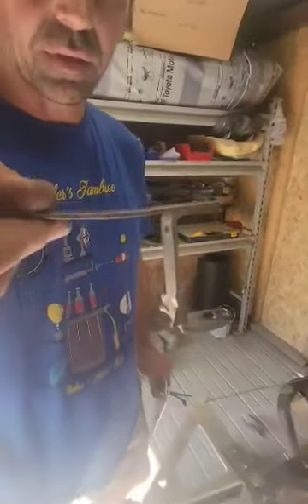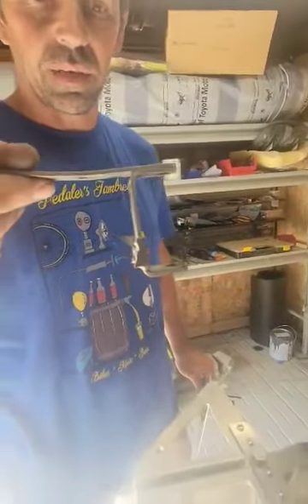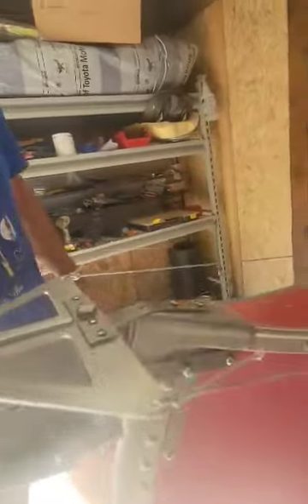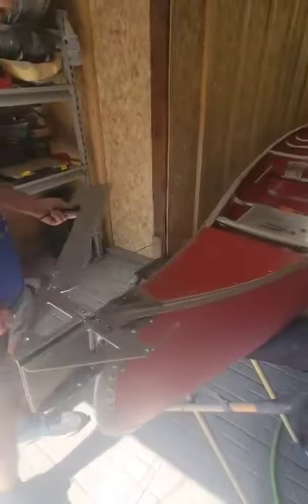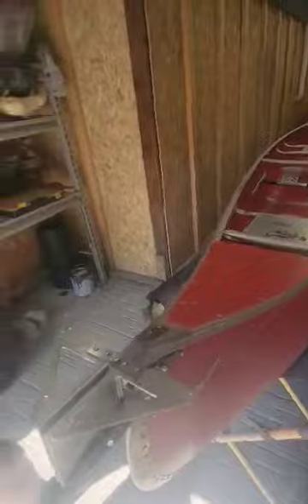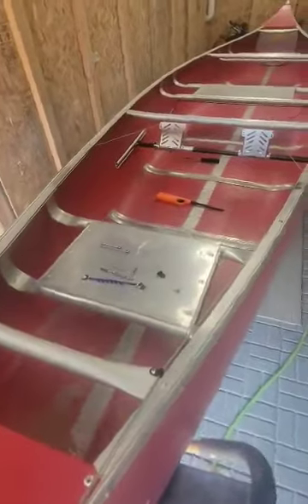The reason to pull this out: if you don't and you travel down the interstate, this happens. It literally puts forces on it that it's not used to because you're going 65 miles an hour, and it rips the bottom bracket off the boat — it's just too much weight upside down flopping around in the wind. We've got a video on a Minnesota 2 as well. They're a little bit easier just because of the design of them, but we can pretty much put it on anything you've got.